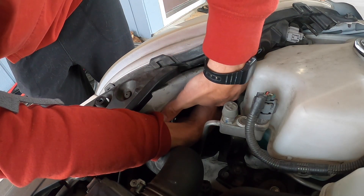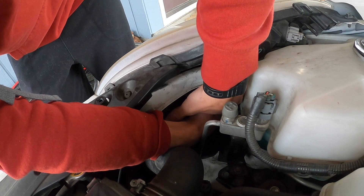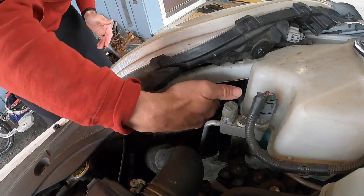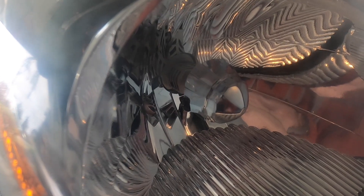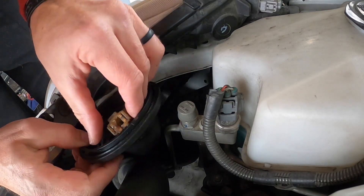It should catch in here somewhere — that's probably the hardest part. You just kind of have to feel it get in there and catch on it. That wire clip should be putting pressure on it, holding the bulb in position. It seems like the LED fits behind that little hood within the headlight assembly, so that's a good sign.